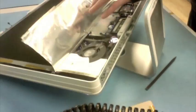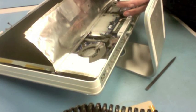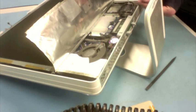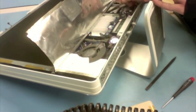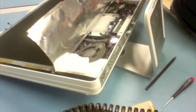Once I have this one flap open, there are a couple cables in here that I am going to set free before I move any further. There are two T6 screws here that hold the LVDS in place. And we are going to just detach the LVDS there. And then there is another cable here — this thicker black cable — and I am going to undo that. That powers the inverter on the display.